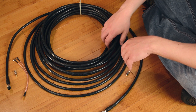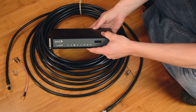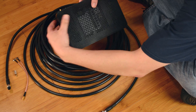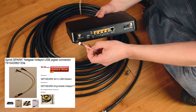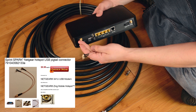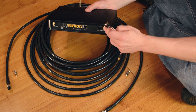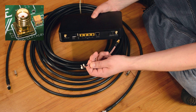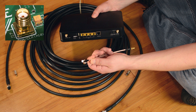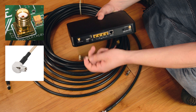As soon as I got it all out, I took my Netgear 6100D and went to hook up this adapter to its two antenna ports. The factory antennas had been attached and I didn't remember what type of connectors these were. It turns out these are SMA females, and this adapter that came with the setup is two TS9 males. Not compatible, obviously.